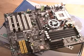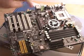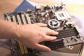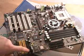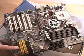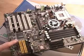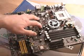This motherboard is based upon the VIA KT400 chipset. Let me now go through and detail some of the key features. Right here is where you install the AMD CPU, and you can also install up to four banks of DDR memory. Here are the IDE controller as well as the floppy controller. Also you have a Highpoint 374 RAID controller on the board. Right here is where you install the serial ATA cable — you've got two connections here on the board. Also five PCI slots and one AGP slot.